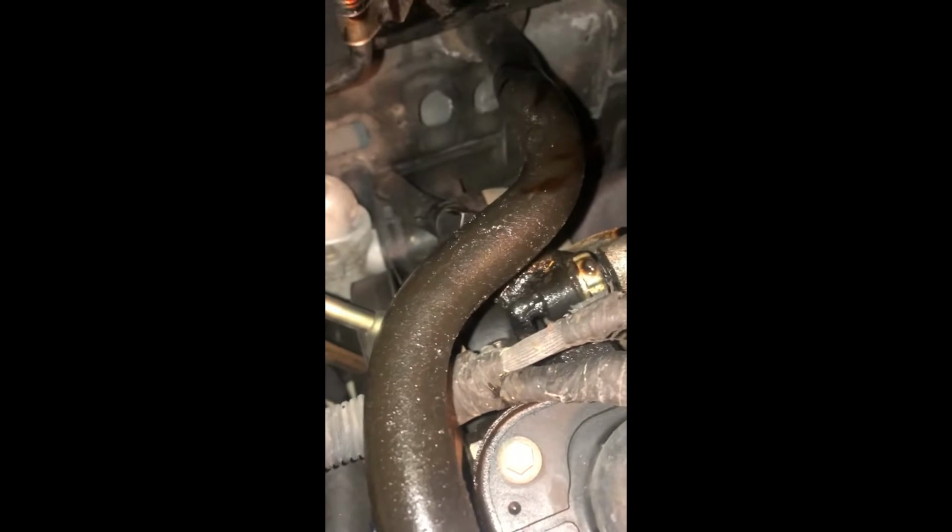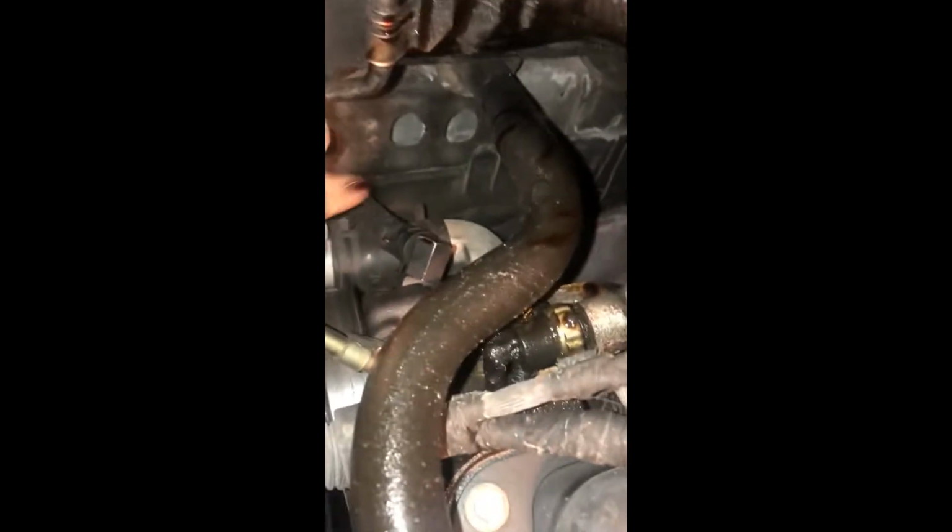Oh, like I said, the joys and difficulties of filming one-handed. And she'll slip right down here, right through there, and out. So, now that it's out, let's follow my path again. This big cavity here, right in the crook of that hose right there. That's a perfect gap in between here, and then it just sits in this cavity, and you can spin her onto the oil filter housing and cooler housing right there, nice and easy.